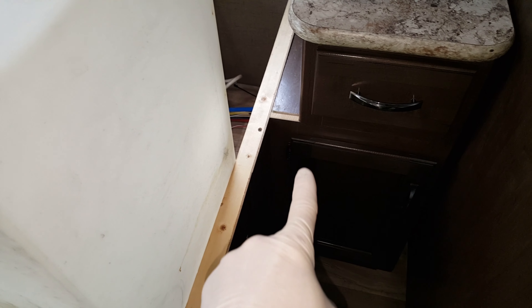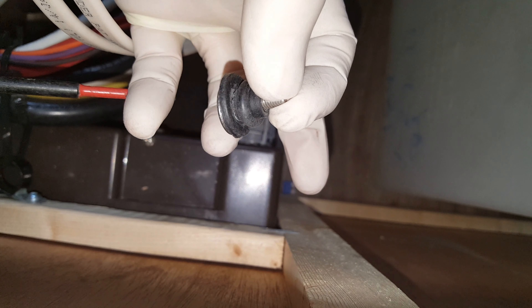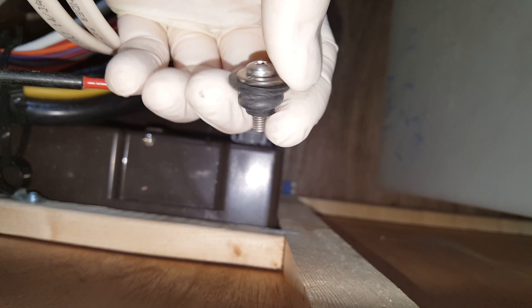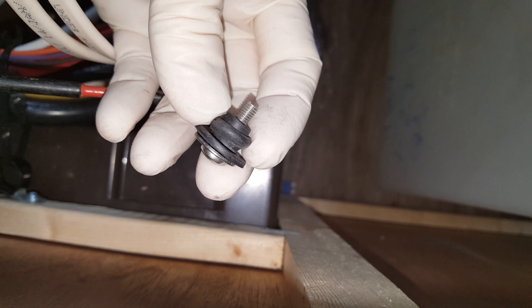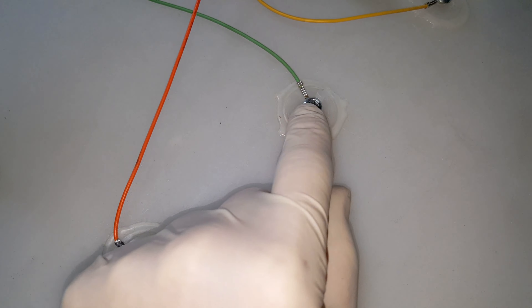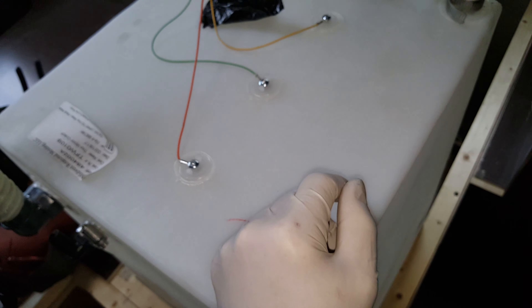Of course, get the screw out of there first. On the normal setup, the screw itself is the probe — it won't get dirty on a fresh water tank, but on a holding tank like a gray or black tank, that's the part that gets dirty and gets stuff hung up on it. This tank actually has spin-in brass tank probes right here already, so all I have to do is drill a three-eighths inch hole, put that plug in, take the screw out, and this thing should be fixed.